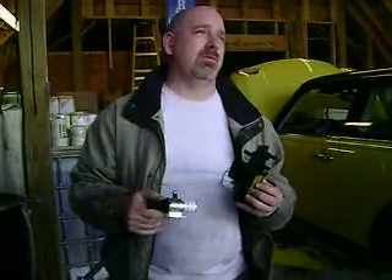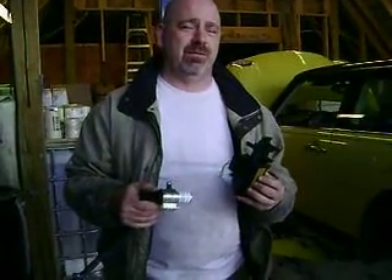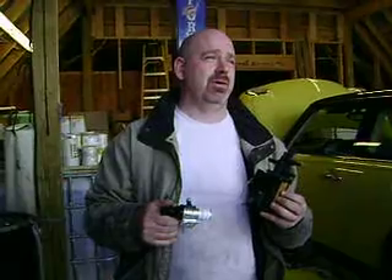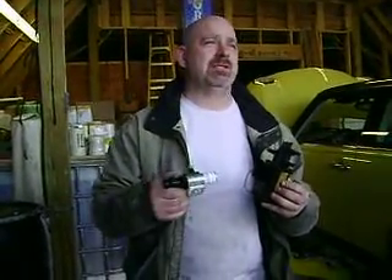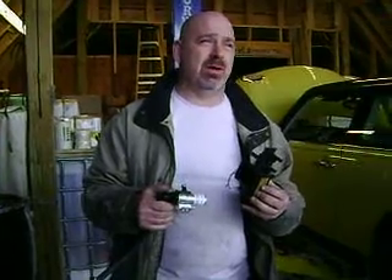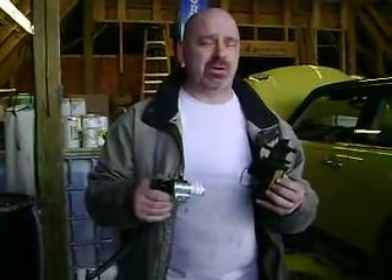What we really have here is a six-port Pollock valve and a three-port Pollock valve. Don't be rattled by a little bit of the veggie being transferred into your diesel tank, or a little bit of diesel being transferred into your veggie tank when you make the switch. It's so quick and the amount is so minute. Don't think you've got to have three three-port valves and super constrictive flow.